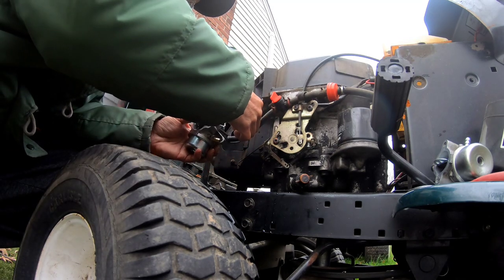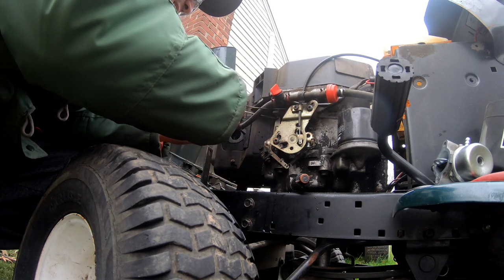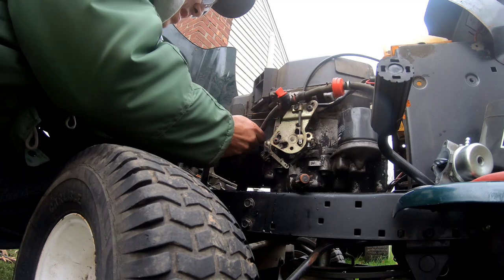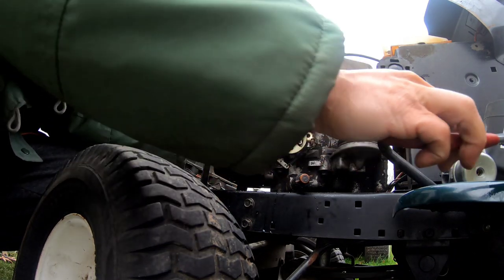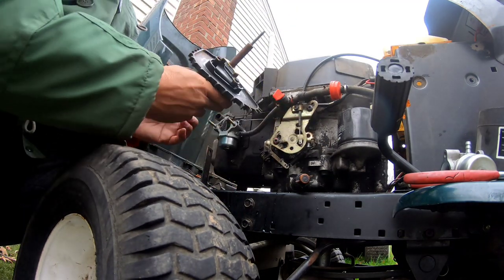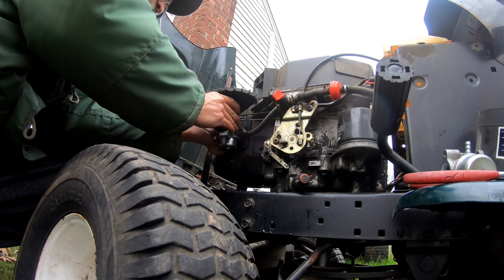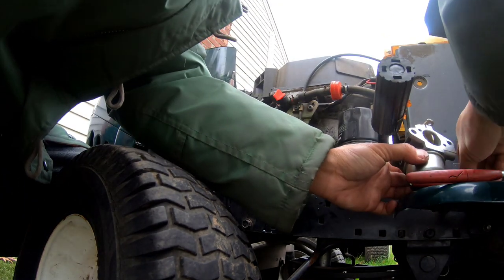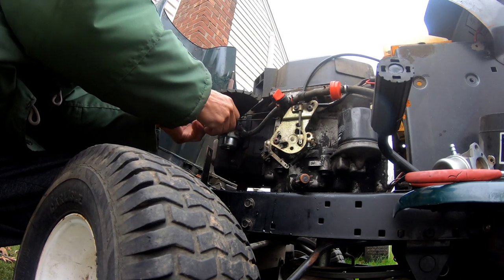Okay, and we'll put the throttle thing through here. Choke through there. Slip it through, gasket's in place. Place the fuel nozzle back on there. How easy is this so far, huh? Super, super easy. It's got a gasket there. Attach the hose. Place the two nuts. You're a nut. Tighten these up, give it a try.